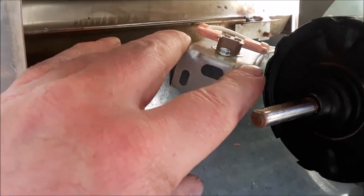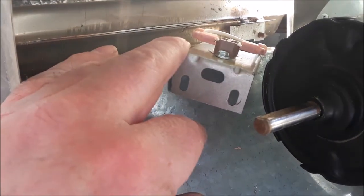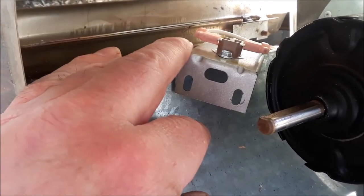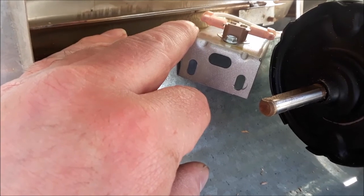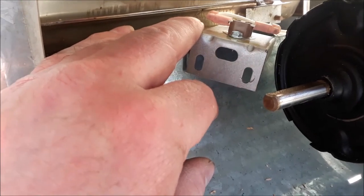As soon as I pulled it out, I tested it because I suspected it wasn't actually bad — I thought maybe it's just the connection. There's just no way to even get at the connection. I put my jumper leads on it and sure enough, it was good. So I cleaned off the terminals a little bit, because I've had problems on this RV with terminals being corroded — not loose, just corroded. Popped it back in, tested my leads, and it's closed, as it should be. The only time that's supposed to open is if it hits a certain high temperature — that's why it's called the high limit switch, and it lives in there with the heater baffle.